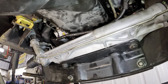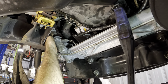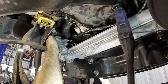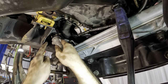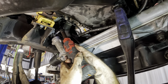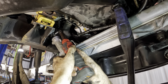It's in position. If you missed it in the last video, or don't know what I'm talking about, the kill people bolt is the one that secures the shaft from the steering shaft coupler to the input shaft on the steering gear. You'll notice that it'll go on and it'll function. But if you forget the bolt, there's a strong likelihood that that clamp will come off, ultimately disconnecting the steering system from the steering wheel. And if that happens, they could get in an accident, and there's a risk that you killed them. That's why I call it the kill people bolt.